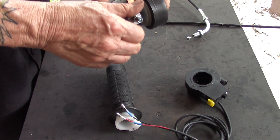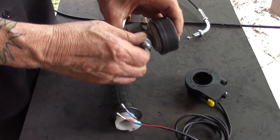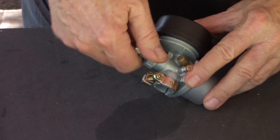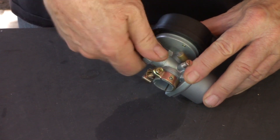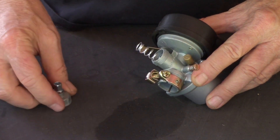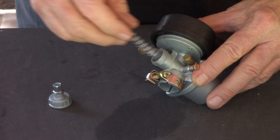Let's take a look at the carburetor install. First thing you want to do is unscrew the cap of the carburetor, and make sure that the cable holder on top of the cap is screwed in all the way — that's going to make getting it installed much easier. We'll show you how to adjust it later in the tutorial.